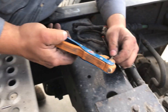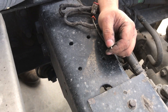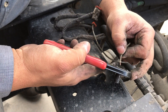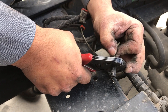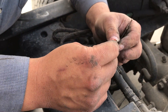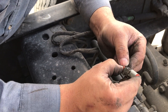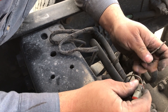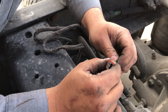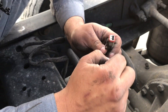I'm just gonna go ahead and strip the wire and get a new terminal, crimp it. These seals are real important. The terminal automatically locks into place.